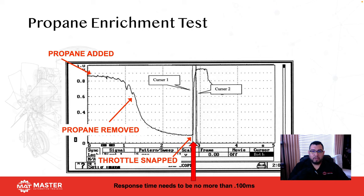Okay. I share this story a lot. I had a Cadillac that came in once, had brand new O2 sensors, diverter valves. It had an air injection code. So most people were telling me, hey, well, it's got to be the pump. I said, well, why? Oh, it has new everything, new this, new that. It's like, okay, well, why not test it? We already did. All right, so I had them drop it off, and I tested the vehicle. First thing in the morning, I got there, started the car up, ran the air injection. I heard the pump come on, but it still set a code. So doing some research, I found out the O2 sensors were the line of defense for the air injection. The computer looks at the O2 sensors to make sure the pump actually came on.